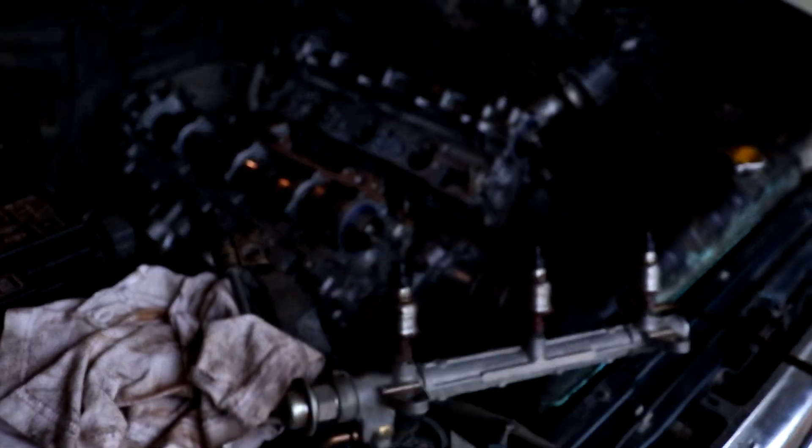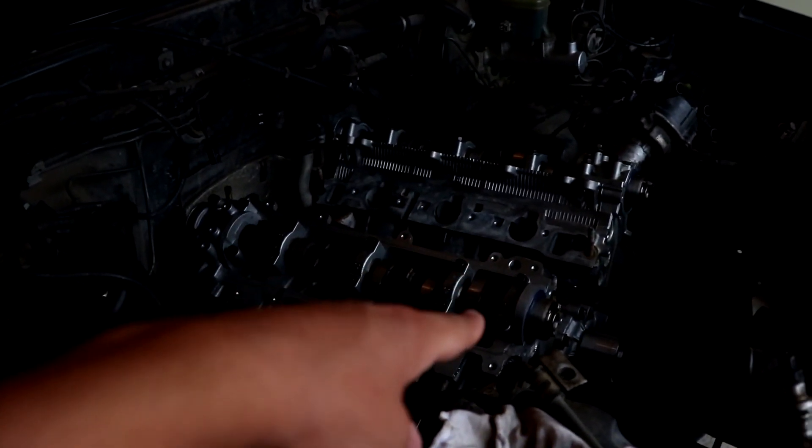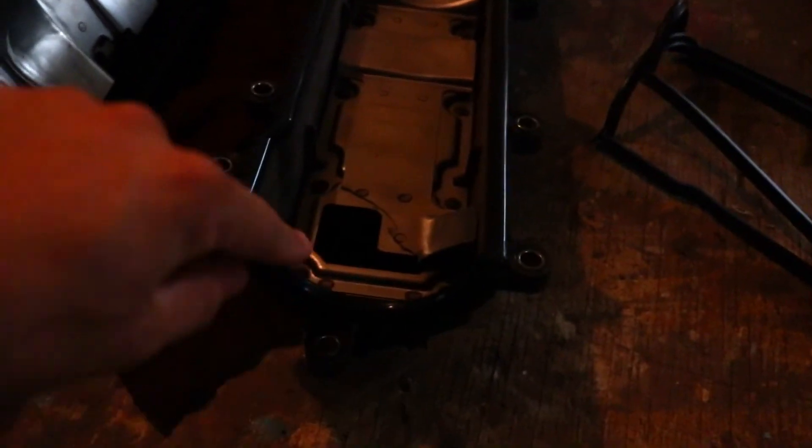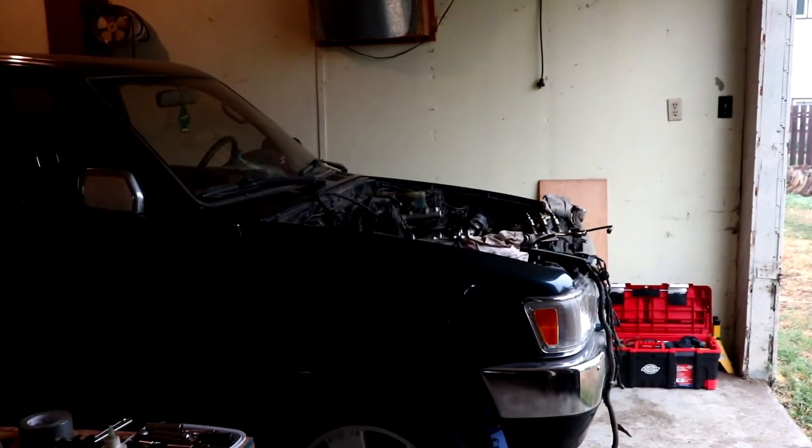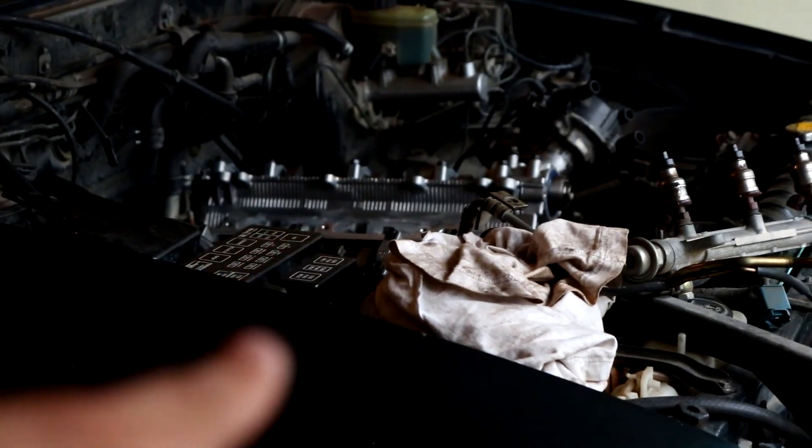What's up guys, it's another day. The truck's still here, pieces are still here and still down. Updating you once again because I'm trying to make this video short. Last time we got the camshafts in. We got the new gaskets on the valve covers — this new rubber bit that goes all the way around. The old ones don't wear much, they just see oil and stay lubed up, but got some new ones just in case. We got the camshafts in but we haven't torqued the bolts yet — that's what we're going to start with today.